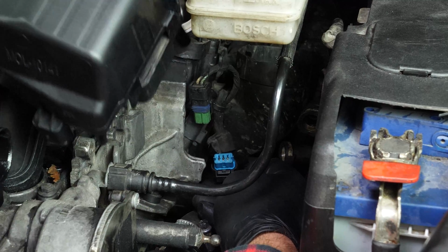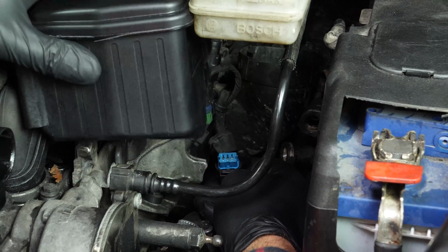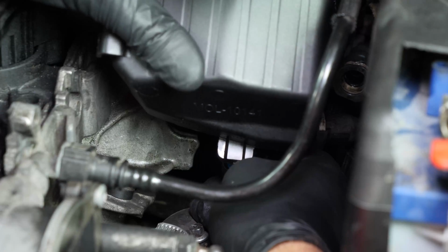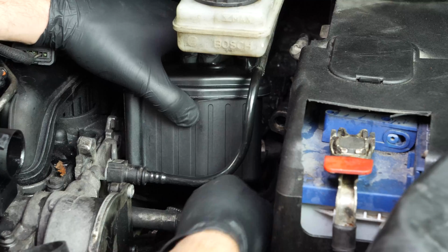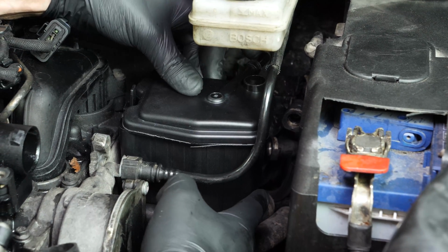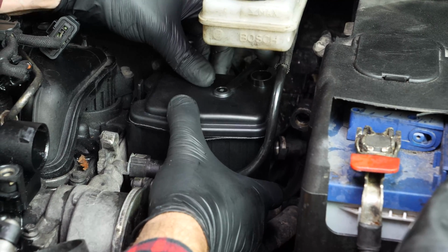Put the filter back in place. Once the filter has been put back, reconnect the water pressure sensor located on the back of the terminal on the bottom. The diesel filter box has spurs that slide along rails located in the cylinder head. You have to ensure that everything fits together and slides correctly.